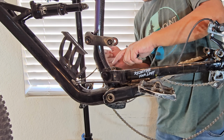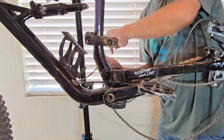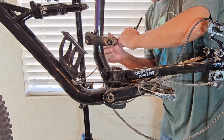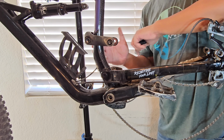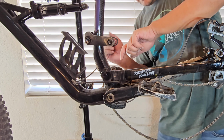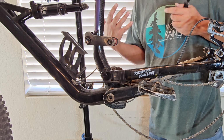And you can just drive those out from each side with something long, and just push them out gently, tap on the bottom, tap on the top, slowly up and down until you wiggle it out slowly. You don't want to just keep on tapping on one side because you can ruin the bearing surfaces. So be careful and push them out of there, and you'll be able to push new bearings into there easily. Use a piece of wood. But if you have presses and stuff, which I don't, then you could do that.